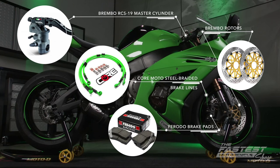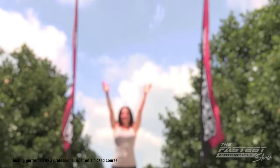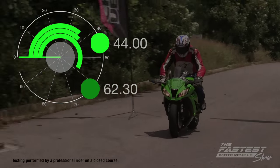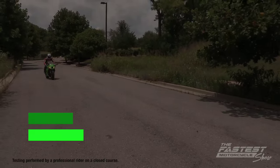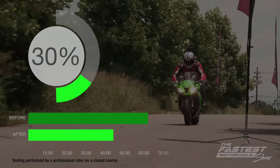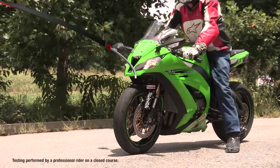In total we spent about $1,200 in two hours. After three runs where Brian stopped at 58, 38, and 36 feet, we have a 44-foot average. Compared to our stock run of 62.3 feet, this front brake performance upgrade has increased our braking power by 30%, and it's given us more feel on the front end, which will allow us to correct little mistakes before they become big ones.